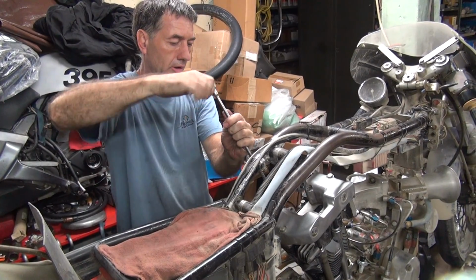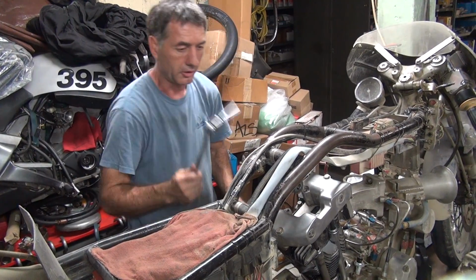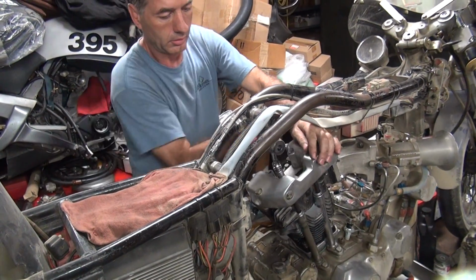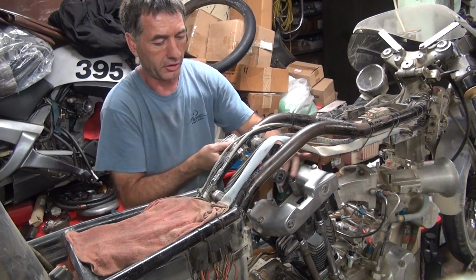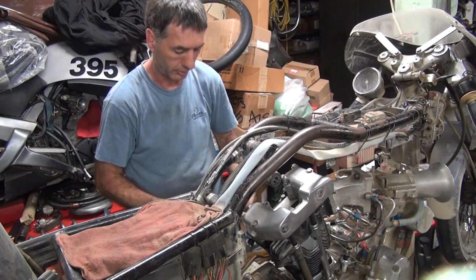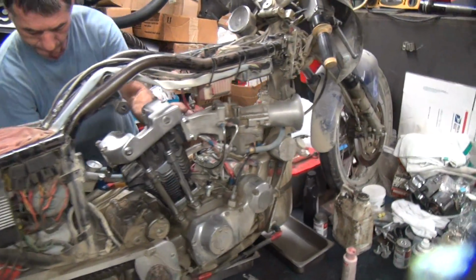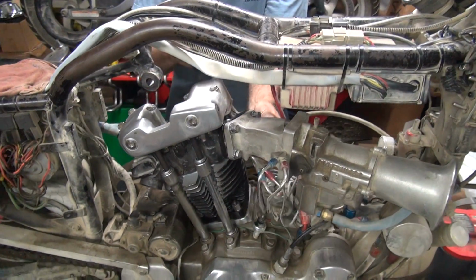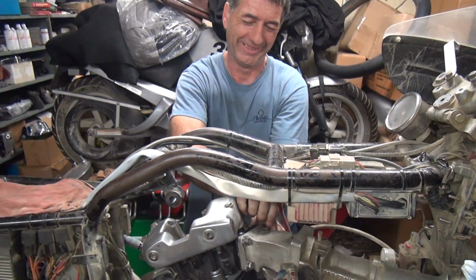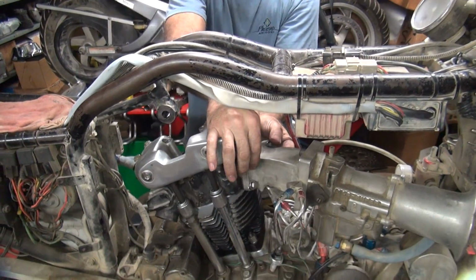Two foot-pounds of torque on there, that's probably about 8 or 10 right there pretty quickly. You take your torque wrench, use an X torque pattern. So you go 1, 2, cross, 3, 4. I don't care which way you cross it. And you go and get the intake manifold on here, but I still got time to do it. Remember, the goo is drying up. Now when it's 110 degrees outside in the sun, it dries really, really fast. Like about as soon as you put it on, it's dry.